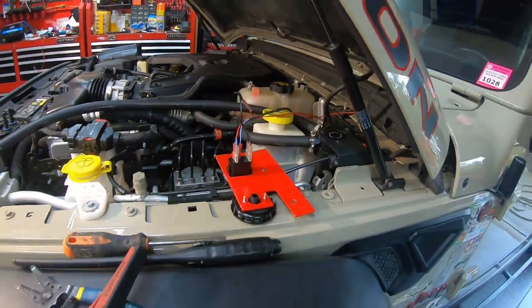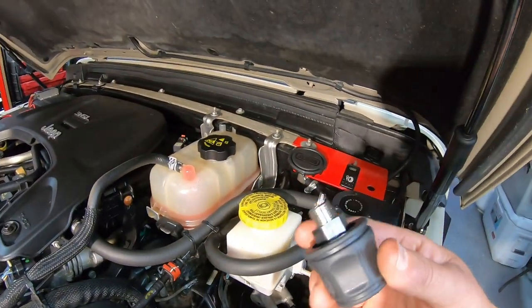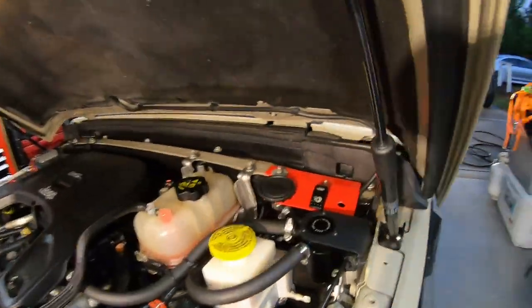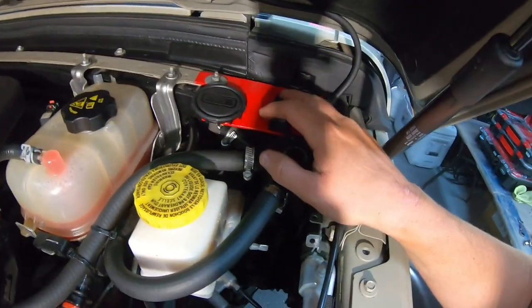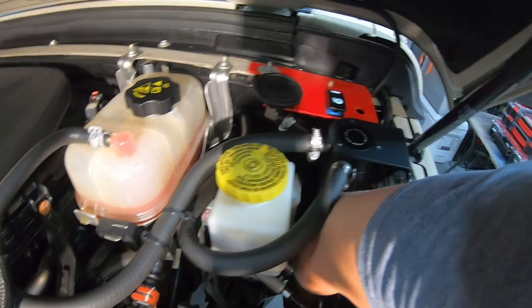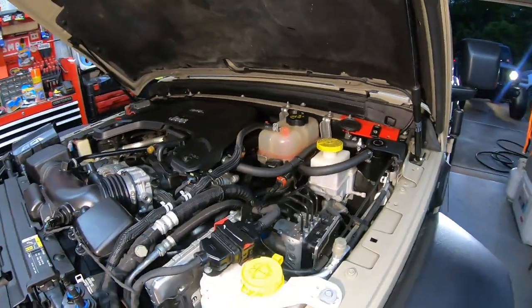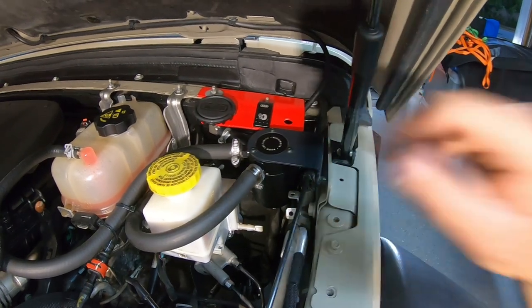As you can tell right now neither light is on — and when the switch is turned on, both are on. I'm going to finish putting this together, put some tape and wire loom on it, and clean it up. You can see we've got it bolted in — I'm still waiting on the last hose part, the one that comes with the kit, and the other one will screw and tighten down on the back side, and then we'll install the hose. That's your end result. When we turn it on and I put my finger down on the hose outlet, you can hear that it actually does shut off with the pressure sensor. The lights will stay on since the switch is on, and as long as there's pressure it will cut off. If you have any other questions, let me know.